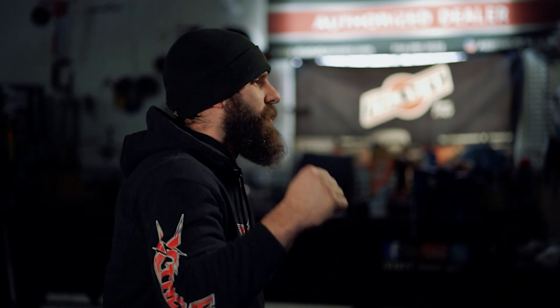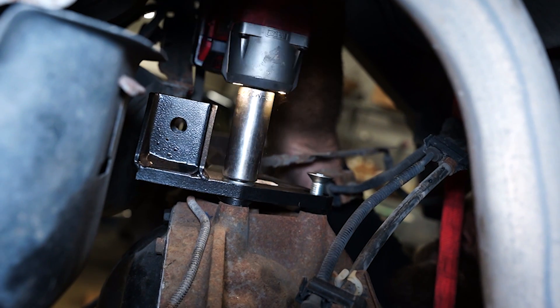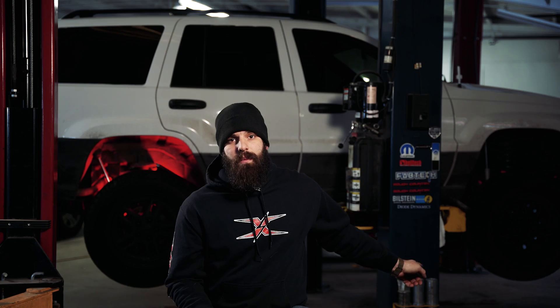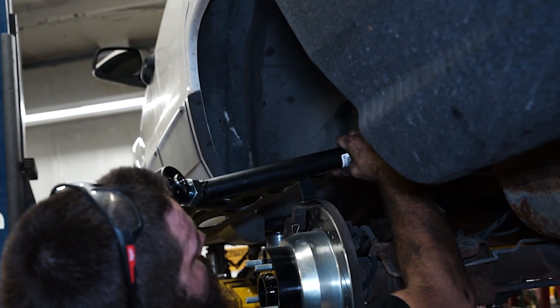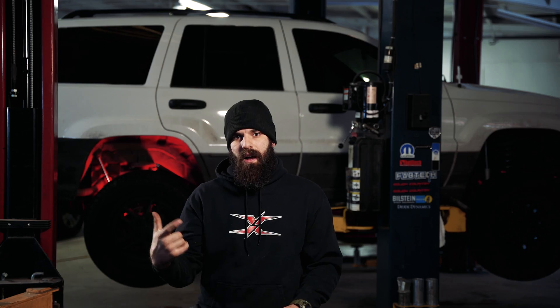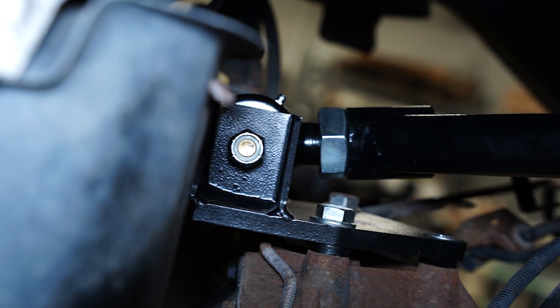After that, you're going to mount the new stealth bomber plate onto the top of the axle. The stealth bomber will have a heim joint in it and they do give you measurements. They make this kit really, really easy when it comes to slapping everything together — I didn't really have to adjust much beyond the front once I got my new drive shaft. Your stealth bomber heim joint's in, the jam nut's in place. Go ahead and throw this into the vehicle, replace the two bolts you took out, and then you'll have a new grade-eight half-inch hardware bolt that you'll slide through.